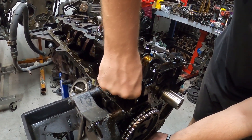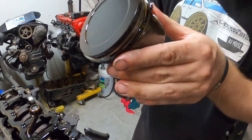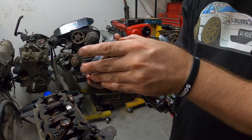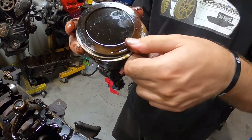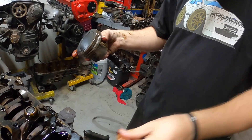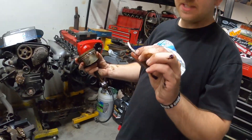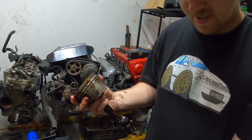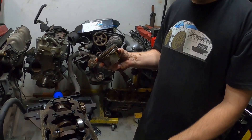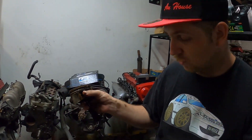I'm going to pop the piece down and look at the piston. I have not pulled a Falcon piston out in a long time. Oh! That's unexpected — we've actually cracked the pistons. There goes the ring land. That'll explain the heavy blow-by — that'll damn do it. Do you want the ring land? This is funny actually, because none of us even guessed that would be the problem. I found the issue, boys! Apparently the ring land doesn't work like that. Well it worked — but also the bearing is very squashed.